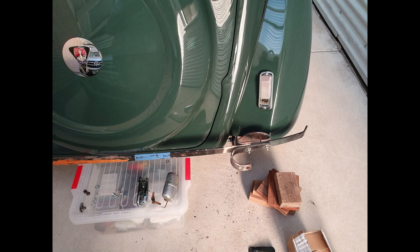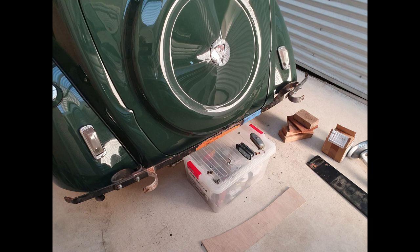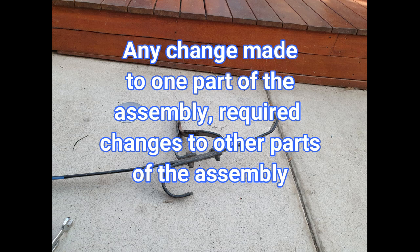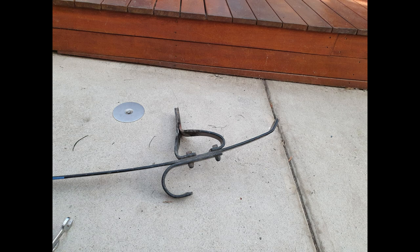The reason I wanted to work on those brackets was I still had the bumper bars to re-chrome, so I wanted to get the brackets sorted out, refit the yet-to-be re-chromed bumper bars, and make sure everything fitted alright before sending them off. Getting this rear bumper bar bracket back into shape turned out to be one hell of a job. The car must have had more than its fair share of bumps and bingles, so this bracket was out of shape in every conceivable way. It was made out of spring steel, so every re-bend required heating with a blowtorch first.